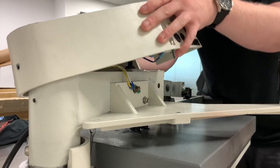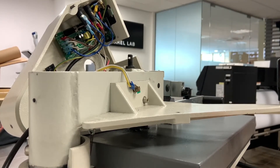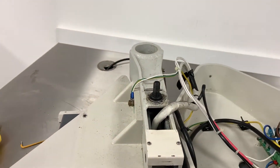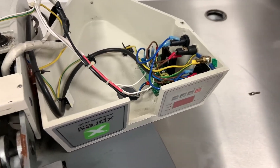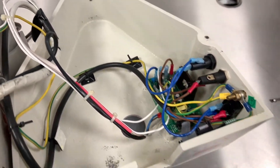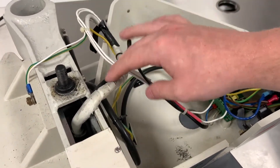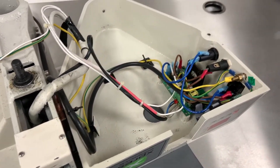Once you've done that, the top cover should be relatively easy to remove — you should just be able to lift it off and turn it to the right, and it should sit nice and comfortably just like that. Now, some machines it's not going to go completely 180 degrees, and that's because this sheathed wire is normally stuck around the edges of the machine. We actually remove that because we don't find that it really helps at all. If your machine's never been opened before, more than likely you'll find this sheath will be stuck around the edge and you can't flip it all the way over. If it is, feel free just to remove the sticky pads and then you should be able to remove the machine nice and easily like that.